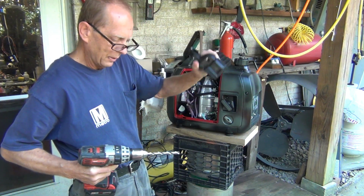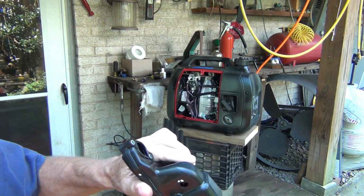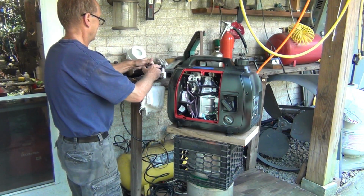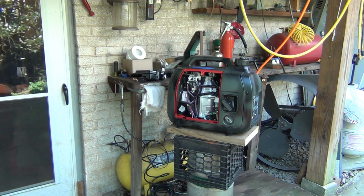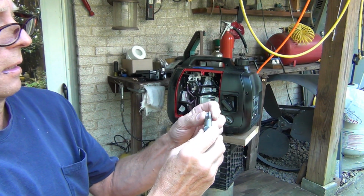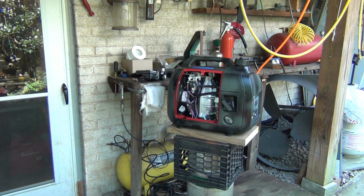Okay, don't push too much, you want to have a nice and smooth hole. So that's 7/16, okay? Now I'm going to get the threader, which I left inside. Hold on. So this is quarter 18 NPT. Okay, that's what it says.